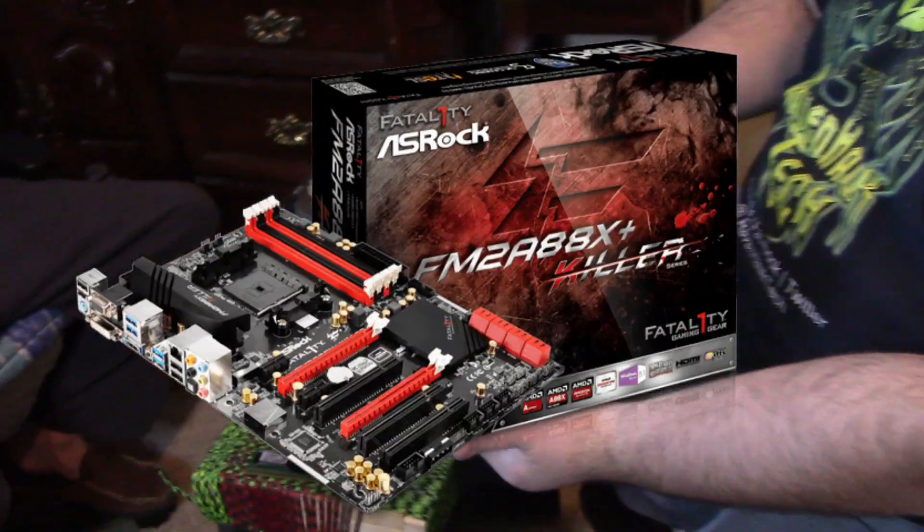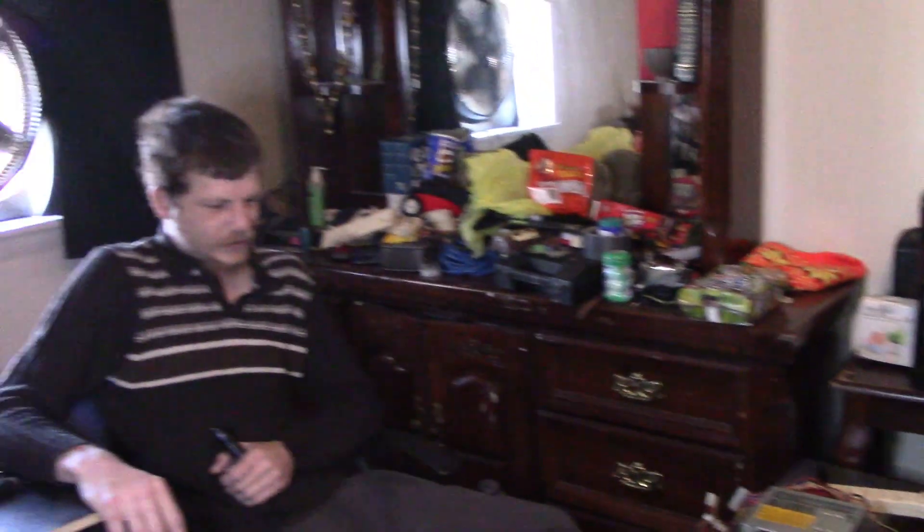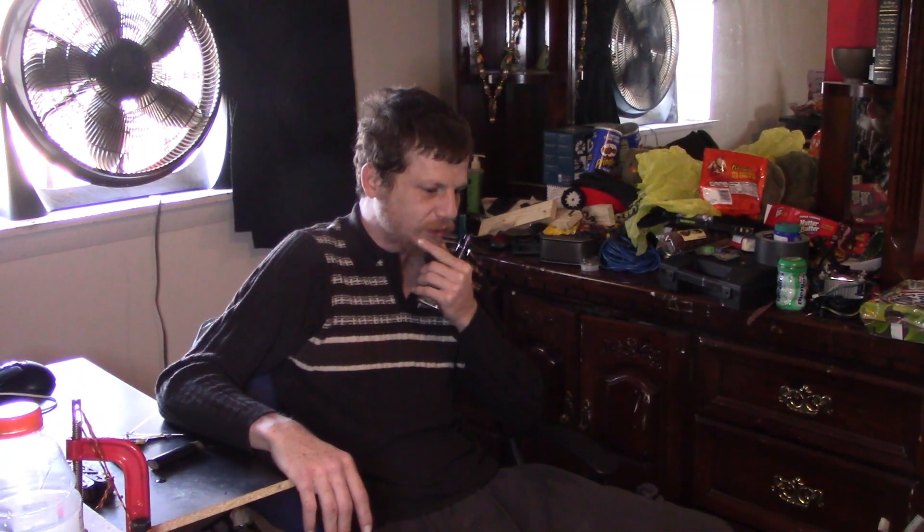This is the motherboard we're going to be testing. Nick, what exactly are the issues? The motherboard will power up, gets to about where it says Windows is loading, then shuts itself off. You get about 35-45 seconds the first time, then about 25-30 seconds, then it drops to 15, and the third time you try turning it on it won't even boot. The only thing I've done is change the CMOS battery but I'm really out of my element, so that's why I called you.